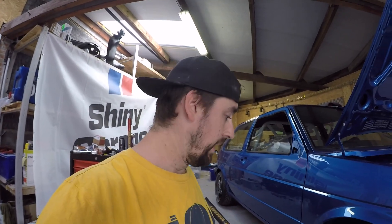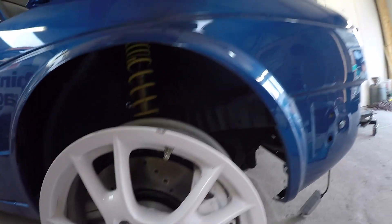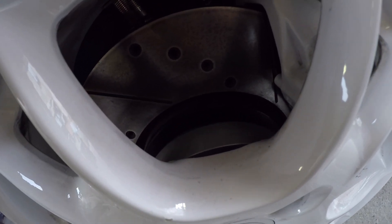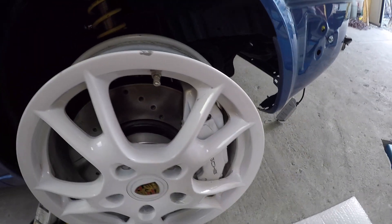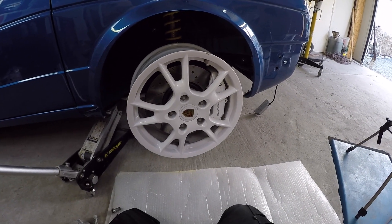Okay, so it fits — I just need two more millimeters and we're going to get away with it. It's just a little detail. As you can see right now, the wheel doesn't move because it just hits here. It's gonna be difficult. I'm gonna take a light and try to show you guys — maybe you can see it, maybe you can't. Just right there. So as you can see, it's really one or two millimeters. I think with a spacer that is 10 millimeters bigger, then there's no problem — it fits. We're talking about two, three millimeters. I get the idea of how the wheel stands on the car, so I'm going to put it down and check.